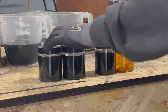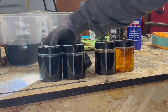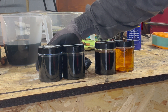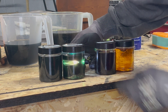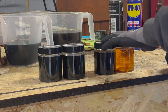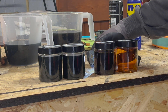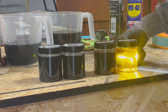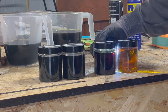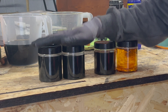This is the old Mechatronic oil, and this is the new Mechatronic oil. If I shine a light through the old one, you can't really see anything coming through at all. On the new one, you can just see a light — a bit of translucency, a bit of green there. This is the old gear oil and this is the new gear oil. Even if I shine a light through that old one, you can hardly see anything — maybe a tiny bit. The new one is a beautiful translucent amber colour. That shows you the difference in changing the oil. So 'sealed for life' is a load of rubbish. VW should stop misleading us and let us take care of our gearboxes.